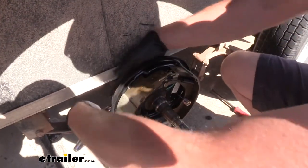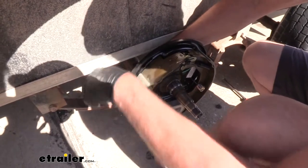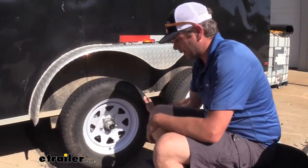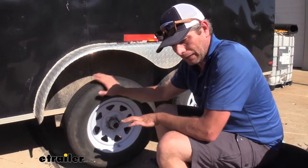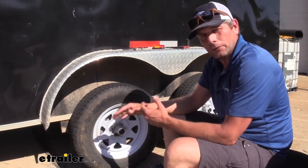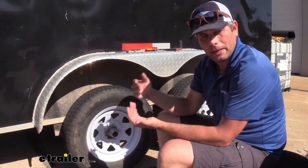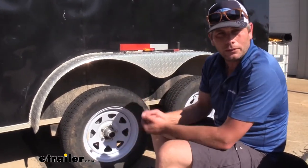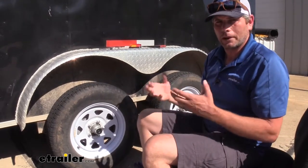Now you want to go through and tighten down our nuts here. There are 3/8-inch studs that come out of the back, so the general torque for that is going to be somewhere around 35 foot-pounds. Once we've got everything put back together, you want to check your brakes. You want to rotate it and you want to hear a slight constant drag. If you don't have that, if your tire spins real freely, you need to expand those brakes out just a little bit. So you can go in the back side with a screwdriver, take that oval shape cap out, and that will allow you to adjust the brake tension. If you've got it on there and you can't move it at all, you need to loosen it up a little bit. This is something you want to do periodically just to check it and inspect it to make sure you're going to have proper braking performance out of your setup.